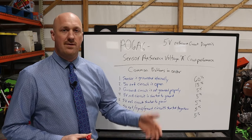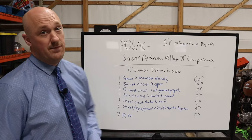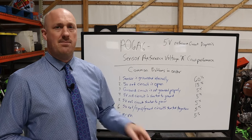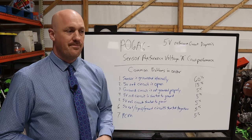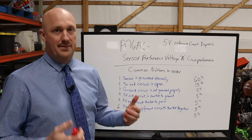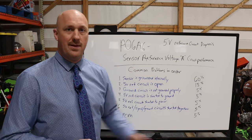If you are having your vehicle looked at by a mechanic shop and they tell you, hey, you need a PCM for this thing, ask questions. Ask them how they came to that conclusion. What tests did they run to verify that the PCM is actually the problem? Now, could it be the problem? Absolutely, I'm not saying that. I have replaced a lot of PCMs myself over the years that have ultimately ended up being the problem.